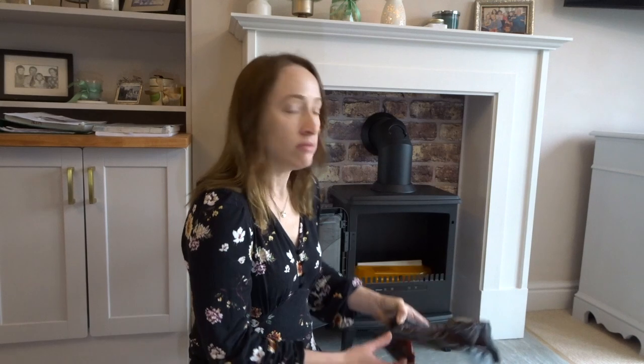You should be cleaning your Optimist Fire every two weeks, and that's really important because water creates deposits inside the fire that can stop it from working. Also, if you're not using it for more than two weeks, then you should take it apart, clean all of the pieces, dry it all out, put it back together, and unplug it while you're not using it.